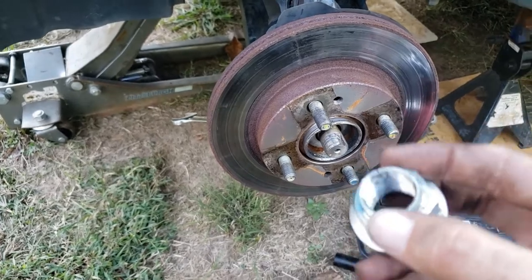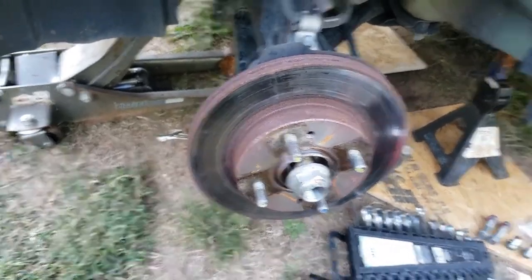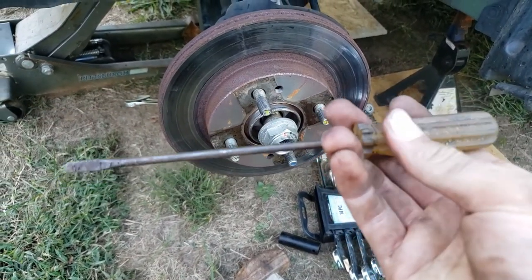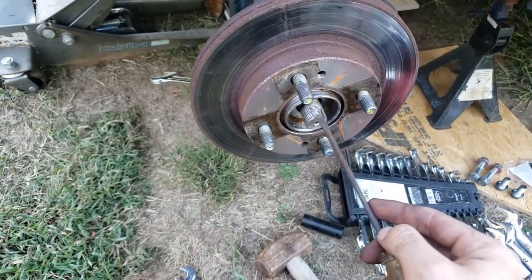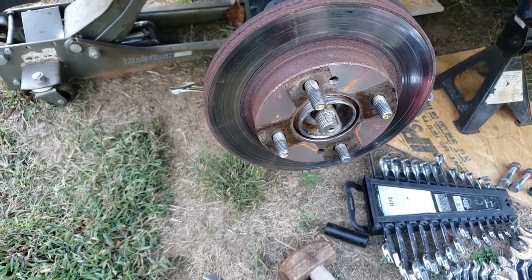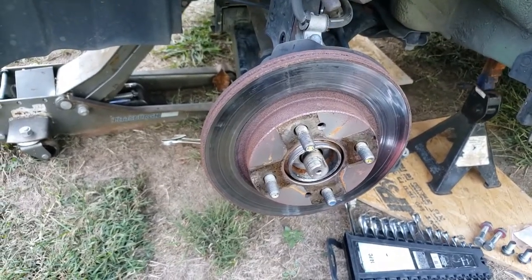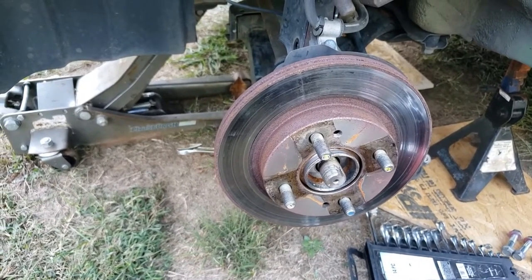What you've got to do is take a flat head screwdriver - I busted the handle off one, something like this - and you slide it in the channel and then just beat it as much as you can upward, try not to gum up the threads too much, and then just crank it off. My impact didn't work so I'm doing this all by hand. Just got to lower the car onto the wheel and then get that off.